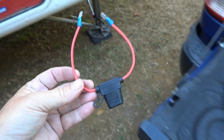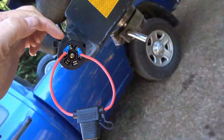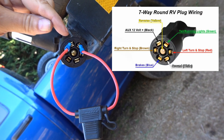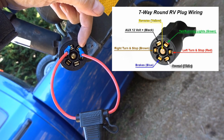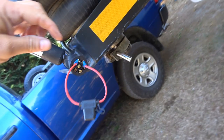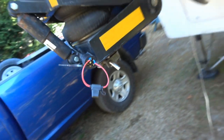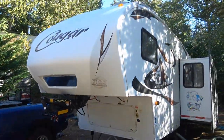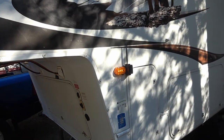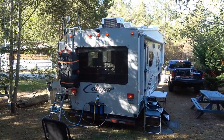Also, this little thing here is a gadget I've made up for turning the marker lights on without the truck hooked up — some people like to do that in a campground. It goes on these top two pins. You can see the keyway — you've got your 12-volt power coming off the RV battery right there, and the other pin is the marker light circuit or running light circuit. This is just a fuse for protection — I have a 5-amp fuse in there — and you can just plug that in. Some people will wedge a fuse in there or get a female socket and wire the same deal. This makes it easy so you can have your marker lights on — you can see the top markers are on, all the running lights are lit up. Just a little trick some people like to use to light up the campground around them.